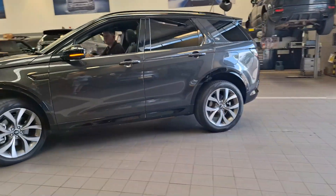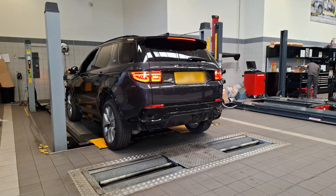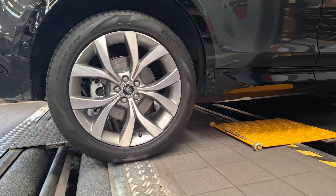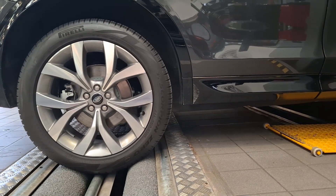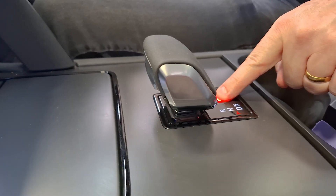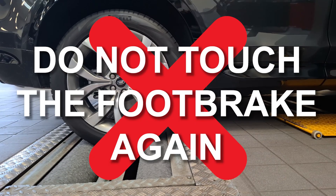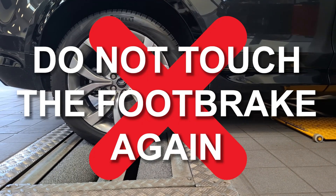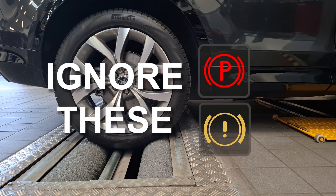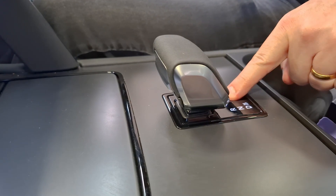To do it on later Land Rover vehicles with the clam-style selector, it's same-same but different. Have the rollers in manual mode again, put the rear wheels in and chock the front wheels. Then, with the engine running and door shut, apply the foot brake and press the P button, hold the foot brake, and select neutral. Now this is important — don't touch the foot brake again until the test is complete. Run the rollers for three seconds; the warning lights might come up again. Don't panic — press the park switch and record the readings.